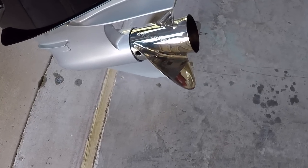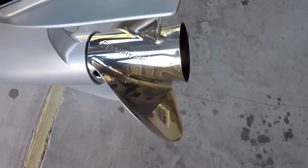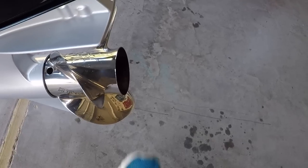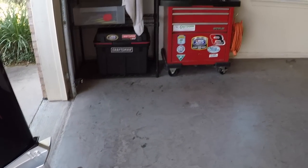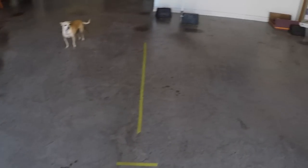Just in confirmation, it was a 24-pitch three-blade Fury — that was the prop we were running. I'm going to come back to this in the grading. We were only turning at 5,800 RPM, so I'll come back to that and the speed on the boat.